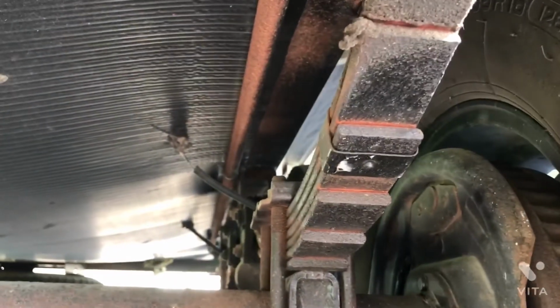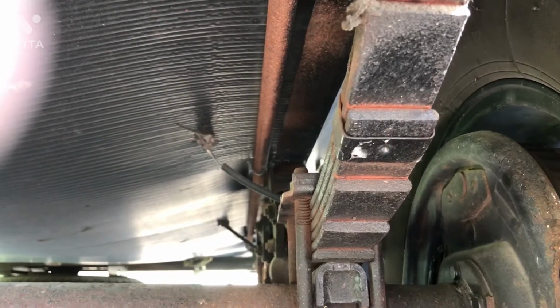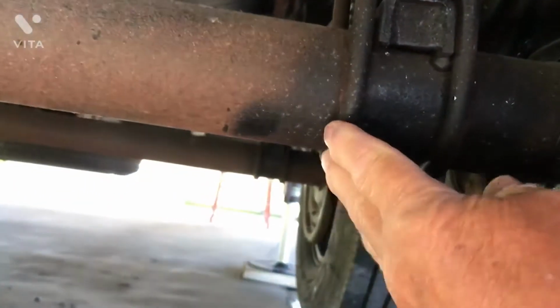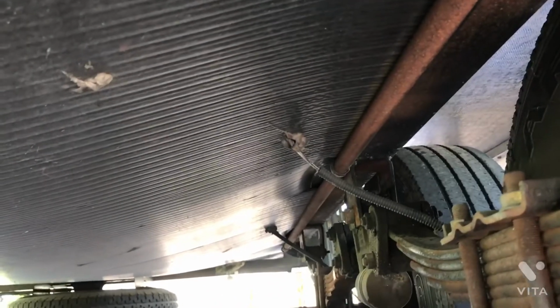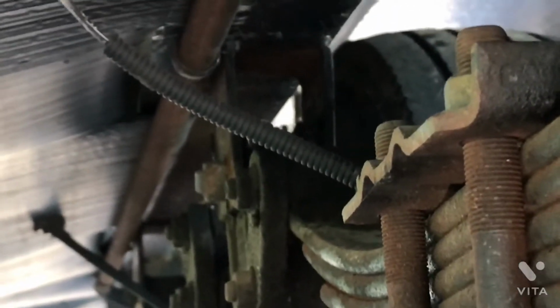And we'll give you a quick little look-see at the front spring. There are 2 springs, of course, one for each axle, and one on each axle on each side, so a total of 4 springs. You want to make sure the U-bolts that hold the spring to the saddle mount on the axle are not damaged, broken, or missing. You want to take a look at the wet bolts that come through on your springs and make sure that they're there. And we're also looking at the brake wiring that's coming down through the coroplast, and you can see that now. And it runs down to the back side of the hub for the axle and runs inside to the solenoid magnet.